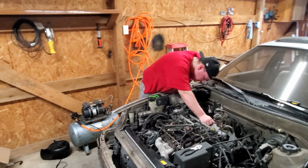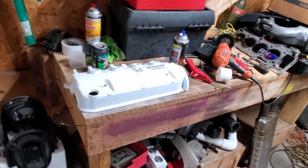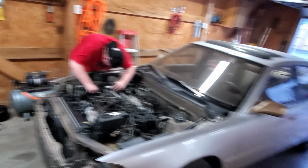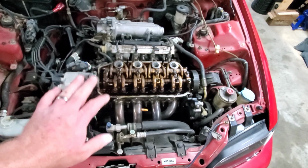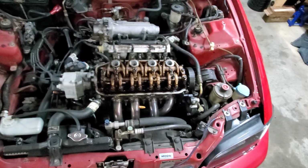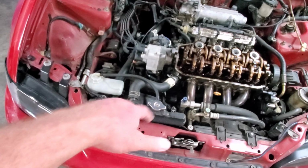Alright, guys, Jacob, once again over there, kicking away on Goldilocks. Here's the finished product of that valve cover. It's got some clear on it. In the next video, we're going to start tearing this thing down. Like I said, we got to do a head gasket, timing belt, water pump, cam seal, crank seal. All the parts right there. Oh, and the new radiator with the transmission cooler as seen there.